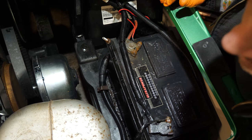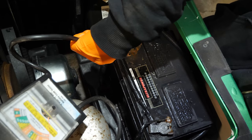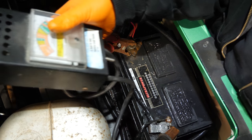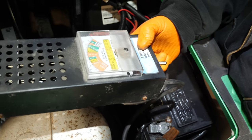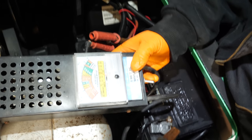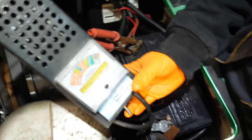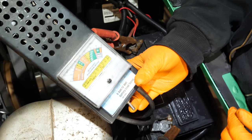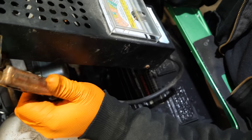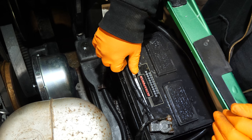Cart is in neutral, key switch is on. We're going to do a charging system test now to make sure it's charging properly — you don't need to load it up for this, it's just to see what the voltage is. You could technically do this with a regular voltmeter. It's riding right about 14.5 to 15 volts, so we know we're good there. As long as it says about 15 volts on this meter, I know it's charging at about 14.6 volts. That meter is not very accurate.